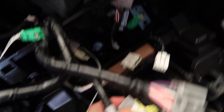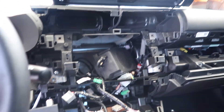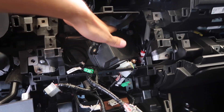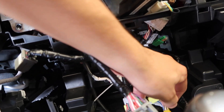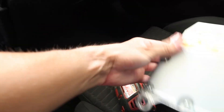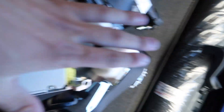This took quite some time because of all the wires and there being no YouTube videos on it — so I guess I was the first one to do it. For anyone wanting to remove their airbag module: disconnect the radio to get access to the two nuts in the back, then disconnect the AC unit to reach the final 14mm bolt, and the module comes right out.